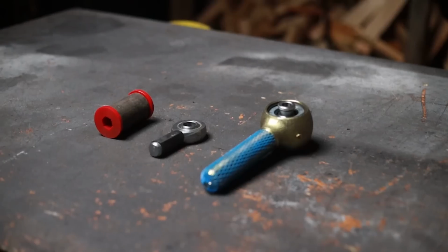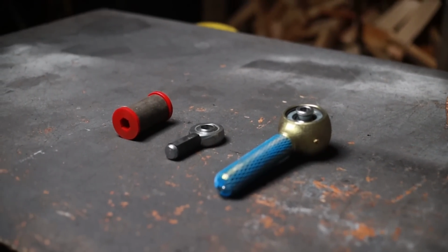The first thing I recommend you consider whenever you're selecting a joint is going to be vehicle weight. The vehicle weight has everything to do with how much demand is on each joint. All that push and pull, all of that weight getting flung around, this is going to dictate what size joint you need. Typically, the larger the joint, the stronger it is, and the strongest joints that I've found on the market so far are the re-buildable flex joints.